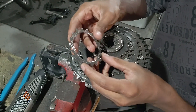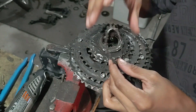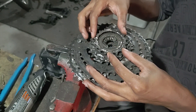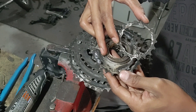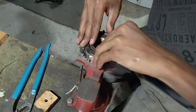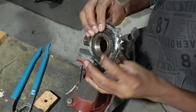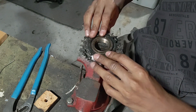This is what the part looks like — it's one of the sprockets taken from the rear cassette. They basically all come apart and I took the 18-tooth one and ground down the inside diameter so that it fits over the freewheel, and I'll weld it onto the outer part that spins. This is going to be tricky because there's a very small lip, so my welds can't overlap between the lip and the inside part. To properly space this 18-tooth away from the rest of the sprockets I'm using a plastic ring, pressing it in, and then putting the 18-tooth on top of that — which perfectly spaces it away.